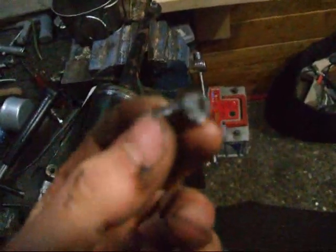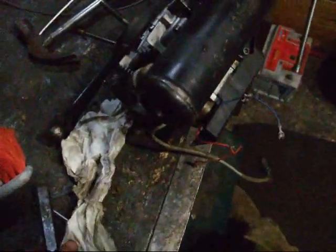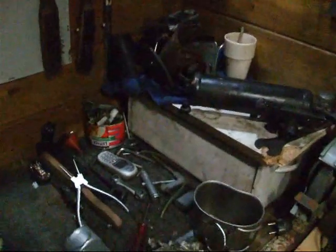There's one here, so we just loosen it up. This one down here. So I take it apart. The screws were rusted down. I get it out, but it's all mangled up. But if a screw is very stuck, I got a tip. Take an old chisel, put it on the side right here, and knock it with a hammer at the end. What we do, it will turn and you can get it out. So easy. We got that thing off, and now we're going to take the carburetor off.